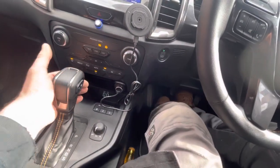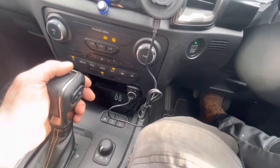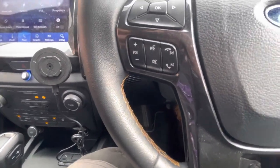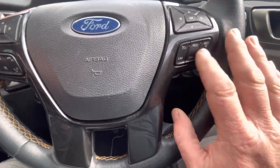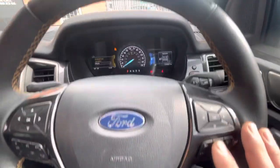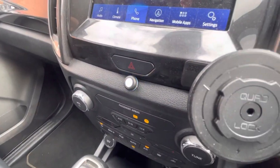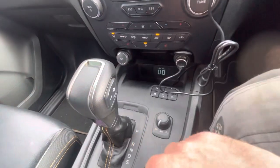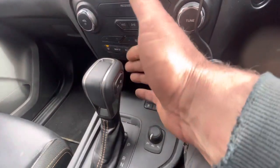So if you can see my foot on the brake there — we've got a gearbox lock. This is a nice feature; it's a second level of authorisation. When you unlock the van, it needs to see the Bluetooth tag nearby to stop the alarm going off. But even still, it's been immobilised. We've used the cruise control buttons on the right-hand side of the steering wheel to enter the code. You'll hear two beeps confirmation and two flashes of the status LED — and that's now enabled the gearbox lock. You can hear the relay clicking.